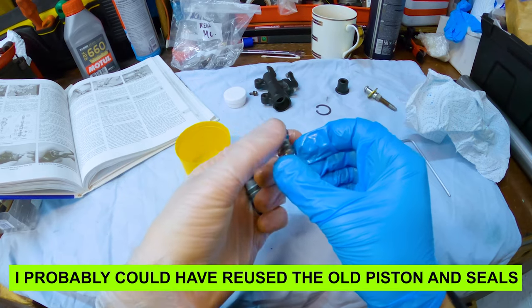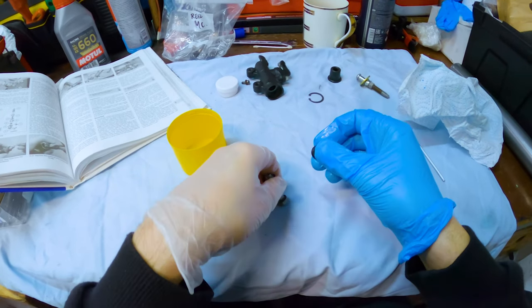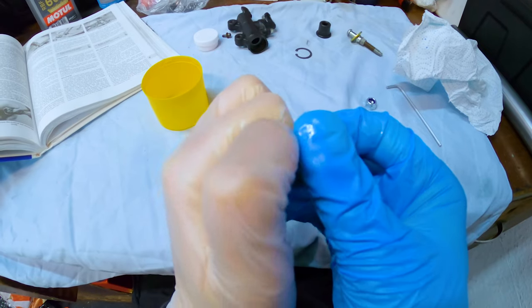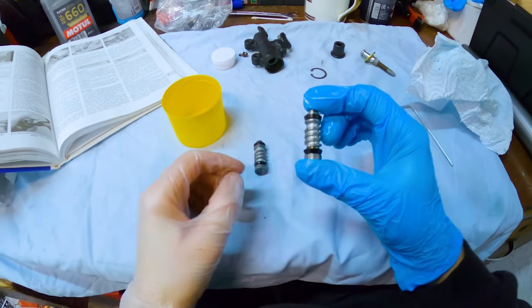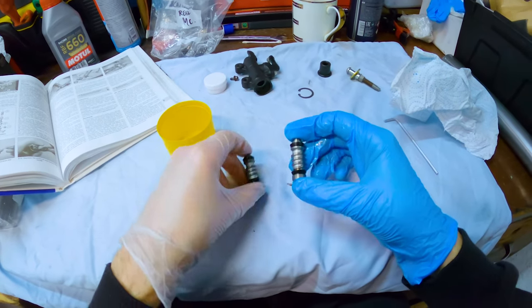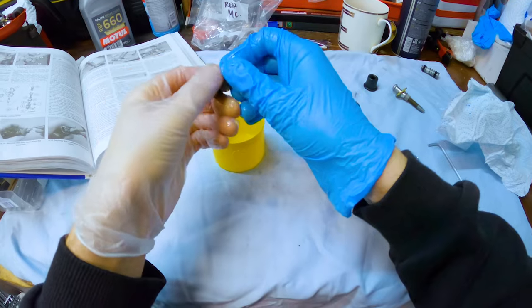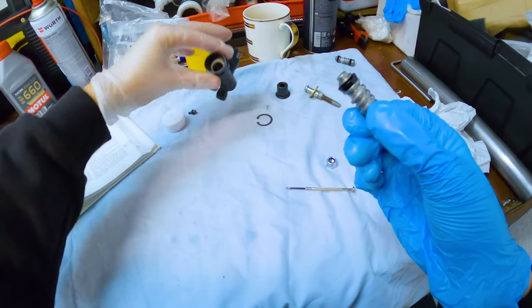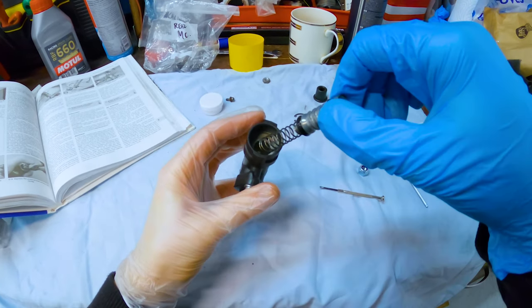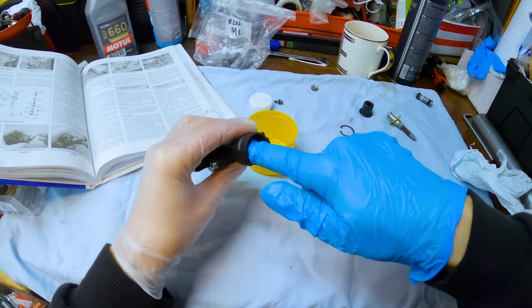Seems to be okay — it's the same one as that one anyway, that's the old one. Do the same with this one — this one's even more, it's a bigger bit to get it over. Right, that bit's on — seems to be in place. Have a quick compare — yep, looks the same to me. Dab the piston with a bit of oil over it. I'm going to put a bit of brake fluid in there as well to try and help it slide in a bit easier.